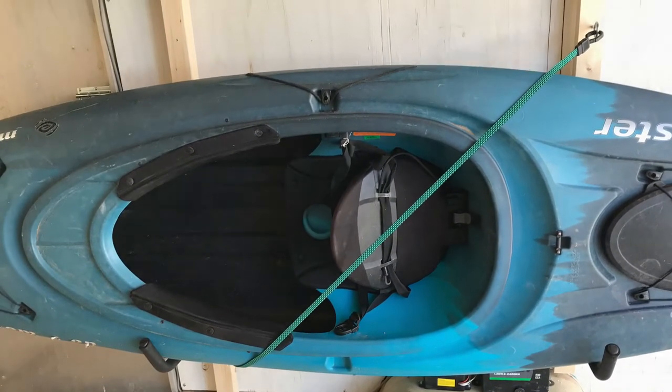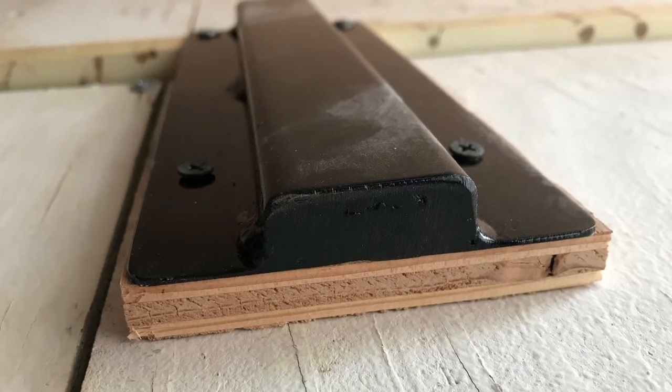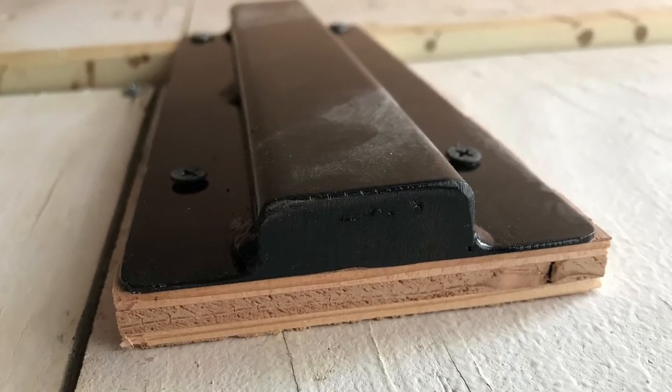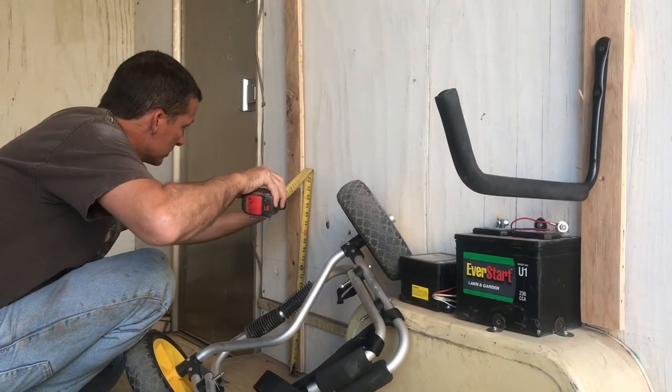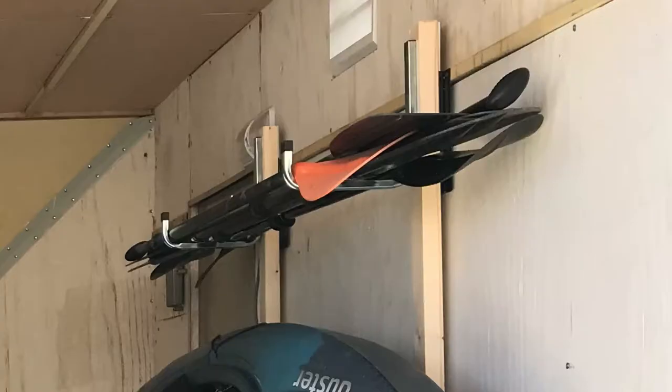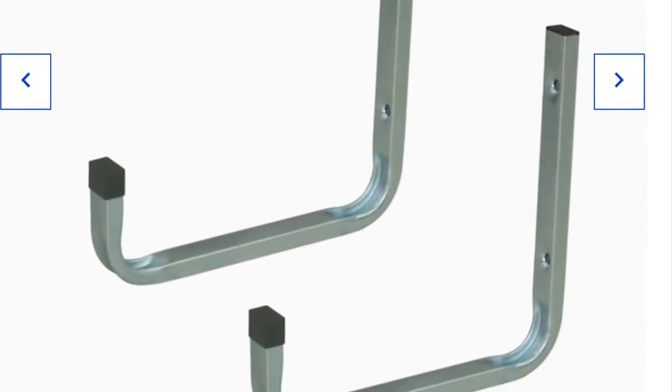I also took some other pieces of wood and anchored them to the bottom to give more of a flat surface on the floor and the wheel well, because I don't want to have to secure them on the bottom. Then I found some pieces of plywood that were the right width and put them between the trailer and the bracket, secured with screws. On the passenger side wheel well I also have a battery for the trailer light, so I didn't have as much height — so I decided to hang my paddles above the one kayak on that side by grabbing some brackets from Lowe's and anchoring them to the two by three.